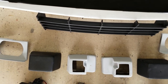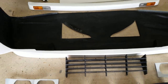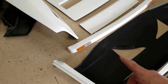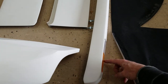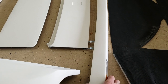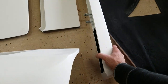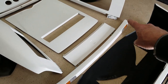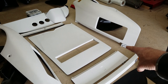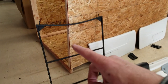There's the grill — it's got the same curve as the front end. You've got the front valance and front bumper. We've already installed the lights for you. When you take them apart, be kind of careful and try to bring that lens straight out this way. If you bend it a little bit it's really in there pretty tight, so you get a nice fit, and you've got access to the back of the lights through there. There's the nose panel — you can see we've got a little flange right here, and over here the nose panel will attach to that. You've got your hood over here, and here's your hood frame.